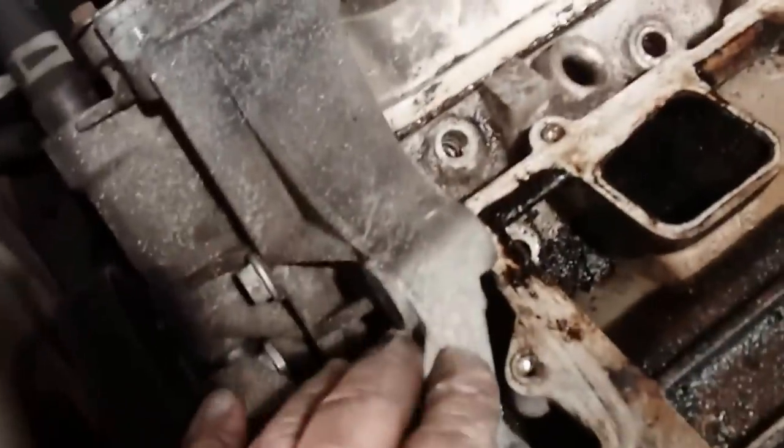All right, like I said, I got the alternator off, so now I'm going to pull off this tensioner assembly. It has the coolant lines, for some reason GM decided to run them through here, that come into this tensioner. And then there's two elbows that come out of the tensioner. You see one down there, and the other one's there going into the intake. If I remember right, I just had to change those elbows, like I said, but it should be, I think, a 15 here and one below it, and then one on the back side.